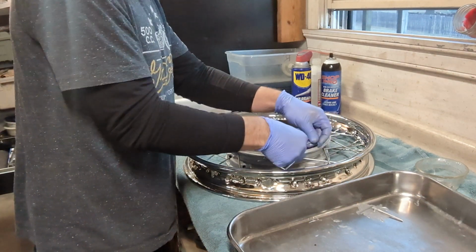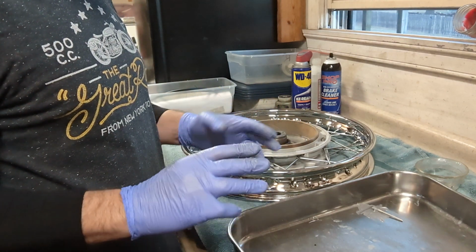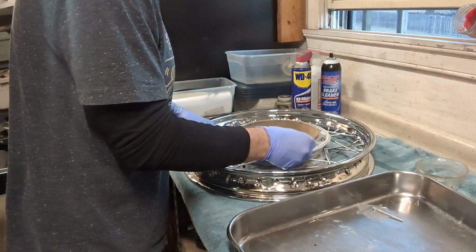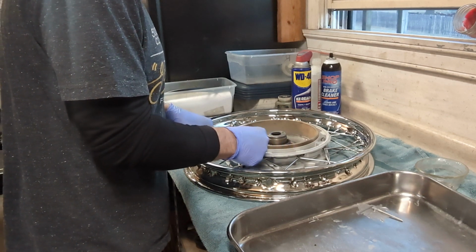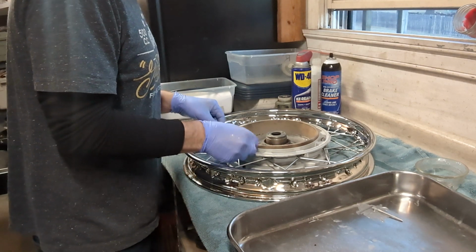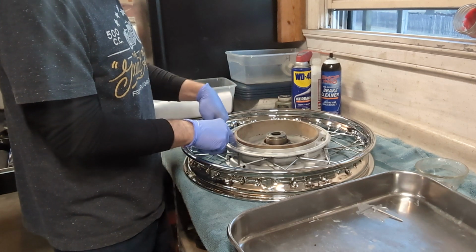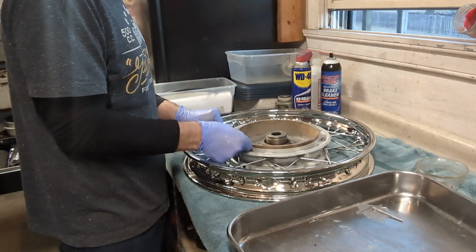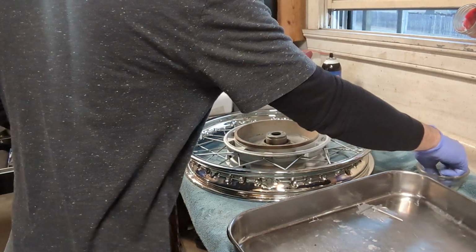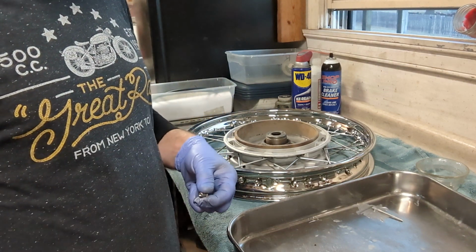And when you're inserting these spokes and lacing these wheels, nothing should be forced. They should go together easily. If you find something is not going in easily, you're probably doing something wrong. So the spokes should just slide in. There shouldn't be any interference with other spokes. Like this one shouldn't pass underneath the other spoke. It should pass on top of it. So just work your way around until they're all in place like that. I'm going to put the final 10 nipples in at this point, and then we'll show you what that looks like.